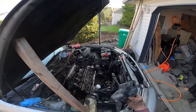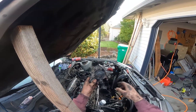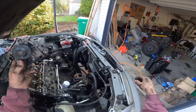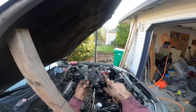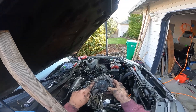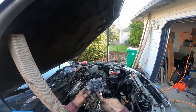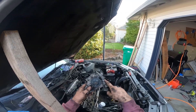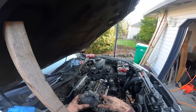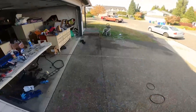Let me give you a little visual representation. This is how the water pump sits in the car. We got one bolt here — this one is left open until we put this piece back. This bolt is going to have a washer, and there are two others with washers as well — so these three will have washers. This one and this one don't have a washer. This one here also holds one of the timing covers on, so it'll be left open for now.